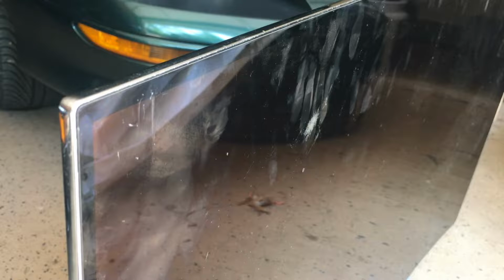An OLED screen differs in its technology from a traditional LCD because the individual subpixels are made out of very small LEDs, and those LEDs on their own are very bright, so it doesn't need a backlight. Because of this, it is able to reproduce colors very accurately.